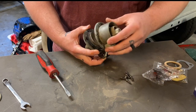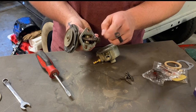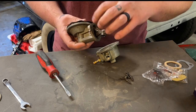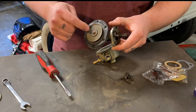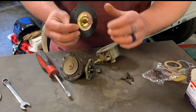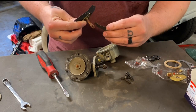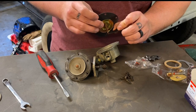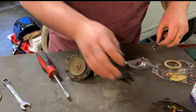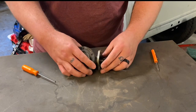Now these two halves are going to split apart. Here are our check valves up in there. Here's our plunger — it's being held by the pump arm right here. The pump arm needs to be taken off and unhooked from the plunger. There's a little hook on the inside that's hooked into the plunger. It's just a little bit of a pain to get apart. Set this aside and we're going to rebuild the plunger part.